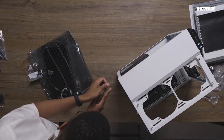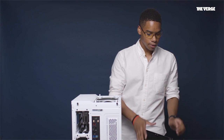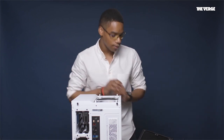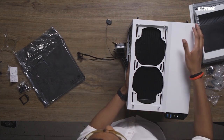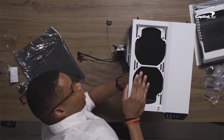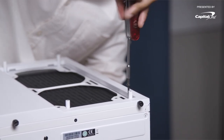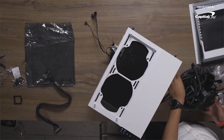Now you just take the required screws and tighten and screw in. Next step, we're going to install the CPU cooler. It's going to go on the top end of the case, and we're just going to have the hose hang out for a little while until we install the processor, which is going to come a little later. Always be sure to try to place it in the system first before you install it, because you can see it takes up a lot of space. In this case — no pun intended — it fits in perfectly, and we're going to start screwing it in. These are really long screws because they go through the entire frame of the cooler, and they're meant to go through the fans.